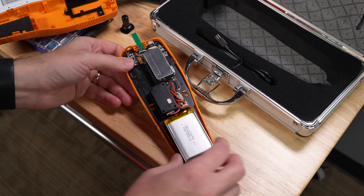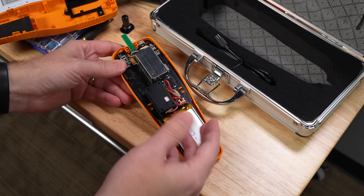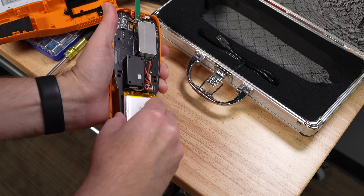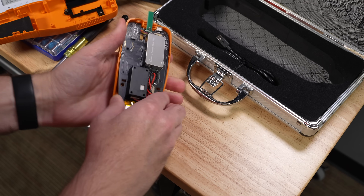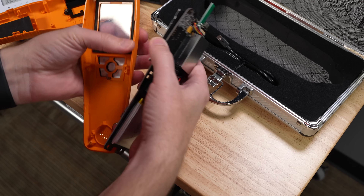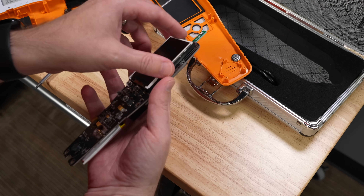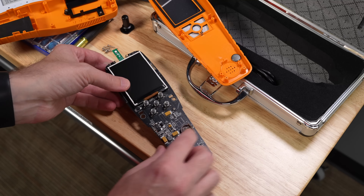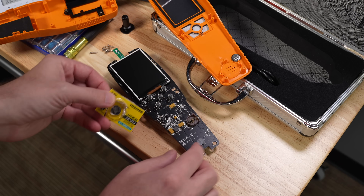I had taken it apart before, and this is the only battery that I found — that battery is actually working fine, it holds a charge and it turns on and off. But that is not the battery the comments were talking about. This is always a little squirrely getting that out of there. The screen is there, which hopefully will still work — it's not glued down or anything, so just be careful if you're taking this apart. But here's where the battery is: it's a CR1220, one of these little guys.